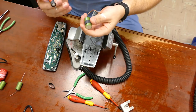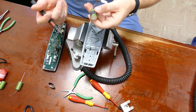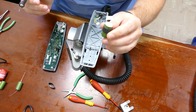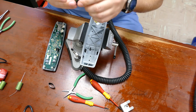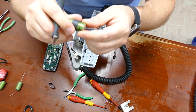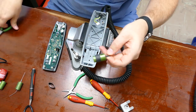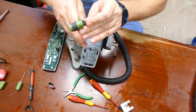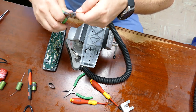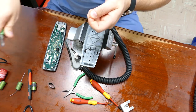The first step is to remove the capacitor either by desoldering whatever's left or clipping it out and starting anew. You can see there's a shrink tube on the outer edges of the capacitor. If you want to see the part number, just cut it off — but none of that's important. I'm just going to go ahead and clip it back.